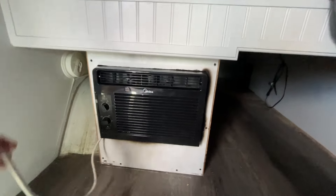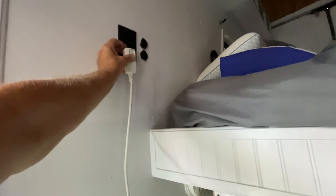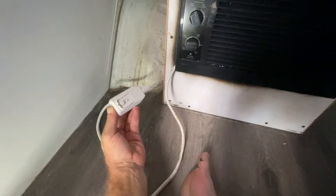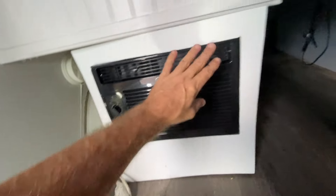Everything is dry fit together. I'm going to leave most of this cord inside so just a little bit comes out — enough to plug in up here. The GFI runs down so it's easily accessible. Then this fiberglass panel will go over the front to make it pretty. That's pretty much finished from the bottom side now. It's dark up there because that is all outside air, and there's going to be some insulation inside that box so any heat that does rise from the tailpipe is still going to be outside and not leak through under the bed.